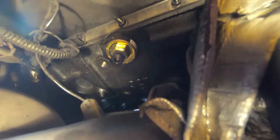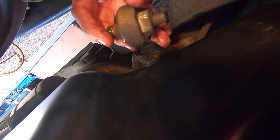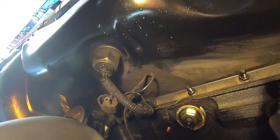Looking at the old sensor — there's a lot of corrosion and buildup on it. Can't really tell whether it was good or bad, and I don't see any part numbers on it, so I can't tell whether it's a genuine part or not. It's obviously been in there a while. At this point I'm just going to clean this up, button this one back up, and then go to the other side.